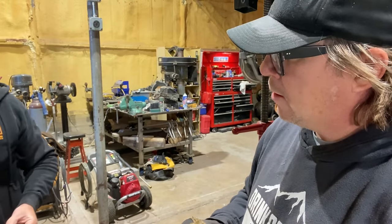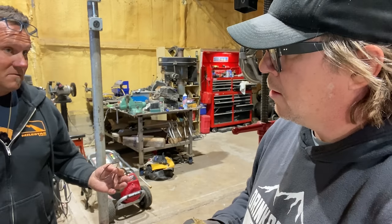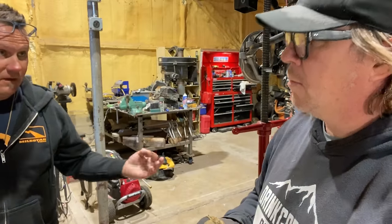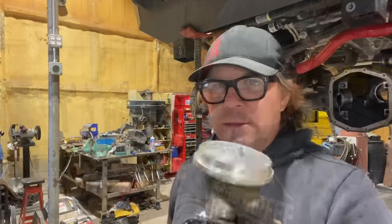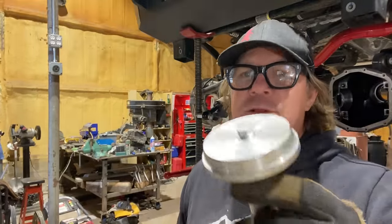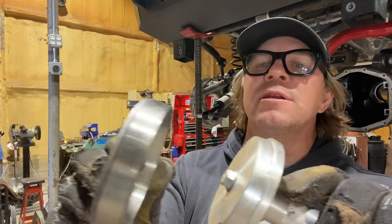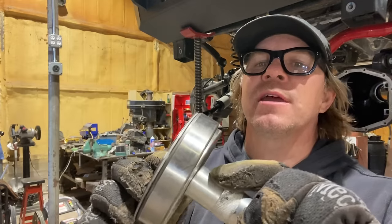And these bearing kits get used with all kinds of things. So not just our gear. It gets used with other people's gears, or with an OE gear. You're just re-bearing, that kind of thing. This is a bearing race driver. It's basically a chunk of aluminum with kind of an angle on it. This is your bearing race. It's going to slide over that.